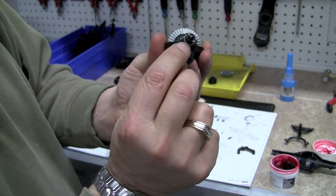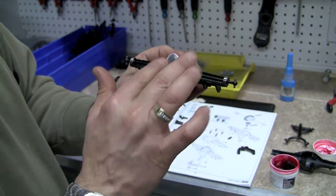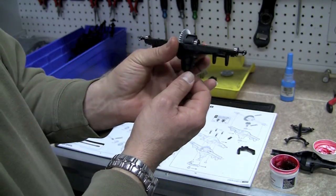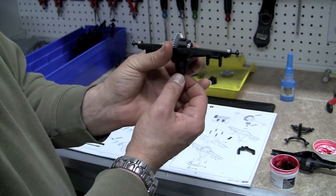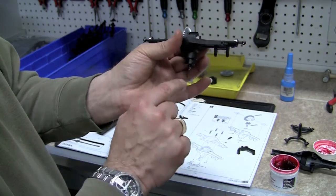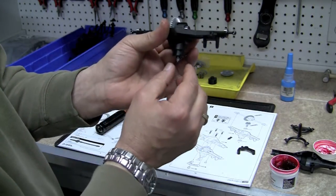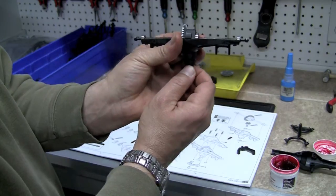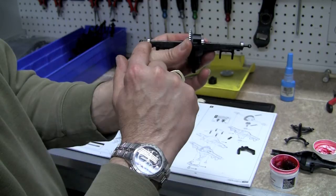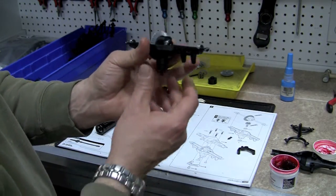We're going to make sure this is turned in the right direction, holding it in the proper direction, and drop it in — those bearings are going to seat down right on the edge of the axle holder just like that. They should basically come right to the edge and that unit drops in. Now we're going to spin this just to make sure there's no binding. You should be able to very easily turn this and it should move freely. If it doesn't, double-check the bottom unit and make sure it's all the way pushed down with the shaft coming out, or make sure your bearings are properly seated on the outside of the axle carrier.